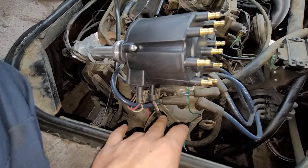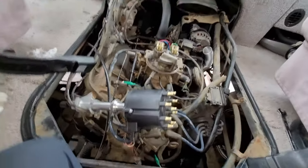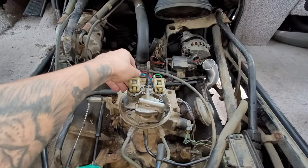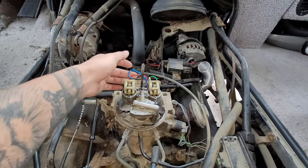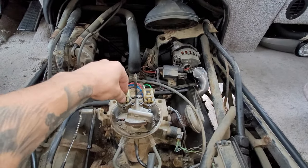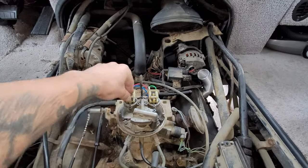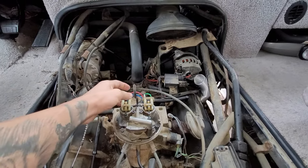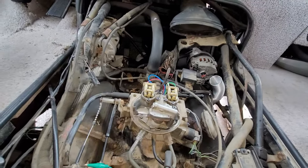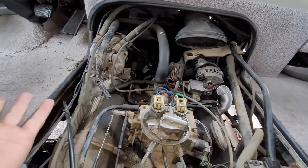It's been about a week since I looked at the wiring diagram. There are only two things that can have an issue. You need to make sure you have a consistent 12 volts here — if not, check your ECM fuse, I think it's ECM 1B on the fuse panel. This one's an RV so it's a little different. If you have voltage going to it, your fuse is good, but check your fuses anyway.